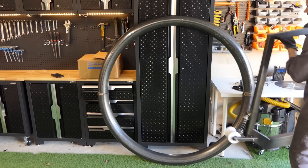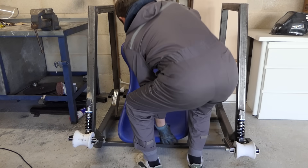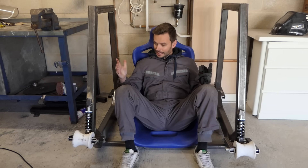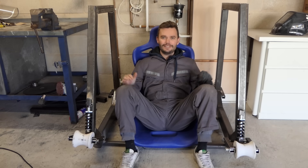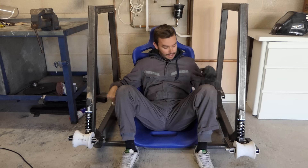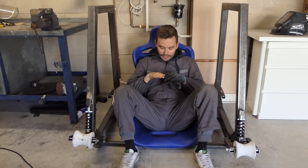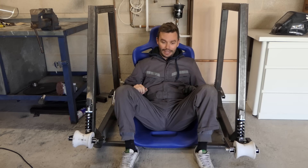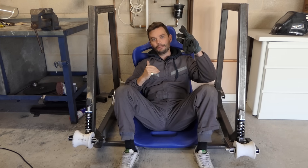With the rods and bearings complete, and the frame and suspension all connected together, it was time to finally put it in the ring. I bought this plastic bucket seat off Facebook Marketplace and I'm going to have a 5-point harness in the future. There's a bit of adjustment required, but that's one of the reasons I have suspension — it lets me tighten one side and the other to get a nice even ride. I need to weld up the bottom bracket and put one across the top as well, keeping more weight down low than up top to maintain a low centre of gravity. Then it'll be time to get this inside both rings and we'll have a nearly fully functioning diwheel.